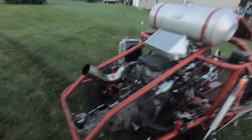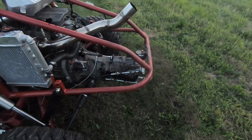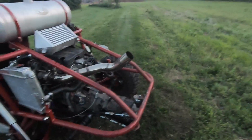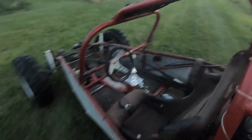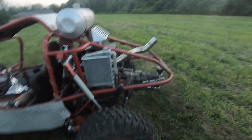Here again with a broken buggy. This is a little different this time. So first of all, brand new BMW transmission mount, or engine mount I'd say, blown to pieces, exploded. So that caused the engine to flip backwards, tear the intercooler off the throttle body, and break one of my temporary brackets for my shifter, but that's okay, we will recover.